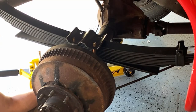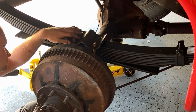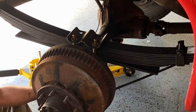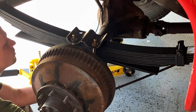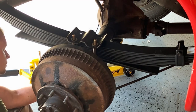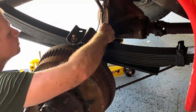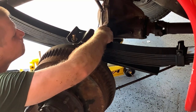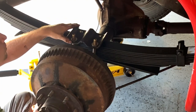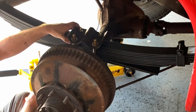Make sure to replace the plate in the same orientation it came off, then bring one U-bolt up from the bottom — you'll likely need to use a mallet to tap it up a little bit farther. Once you're able to secure one U-bolt, place the washers and nuts if necessary over the top and then set the second one in behind it. After using the mallet to tap that into place as well, you'll likely notice that the bell-shaped housing at the bottom doesn't quite meet up yet with the bottom of the axle — that's quite alright, after you have a chance to start tightening it up it'll start to close the gap.